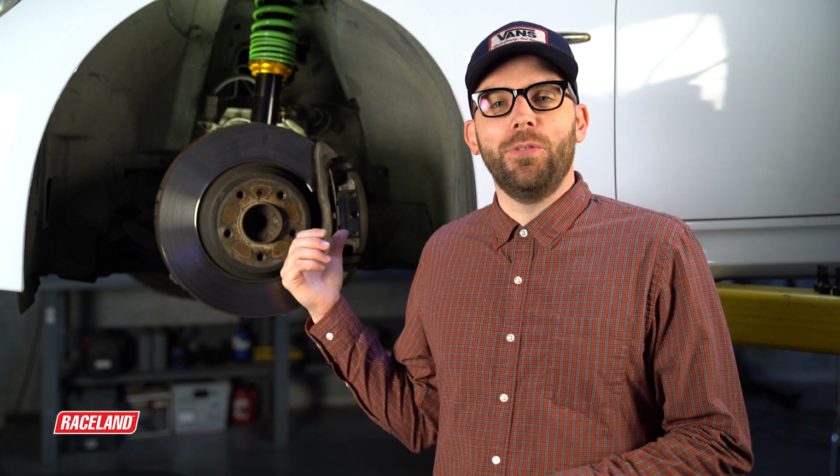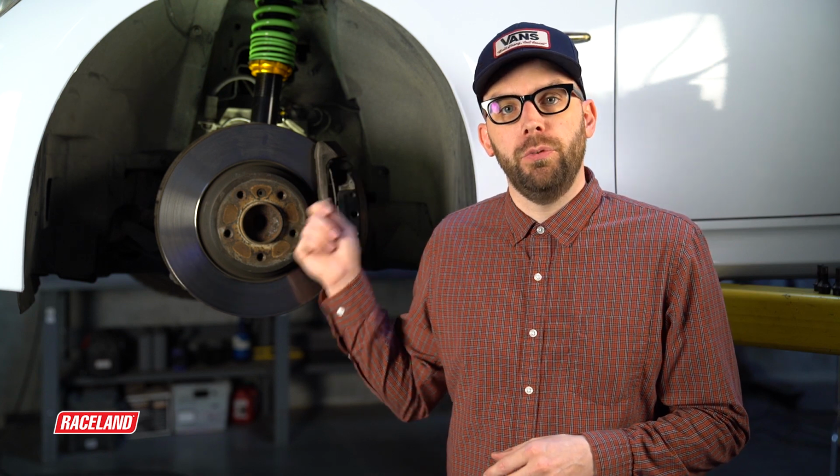Now that you have the coilover kit installed and an understanding of how to adjust ride height on the vehicle, you will need to get a baseline ride height measurement. To do this, you will have to get the vehicle back on the ground. Unfortunately, since each variant is going to differ in weight, there won't be a specific measurement that can be taken off of the shock body in order to determine a specific ride height. This will have to be done per vehicle.